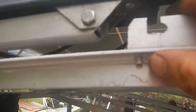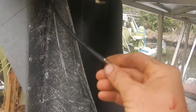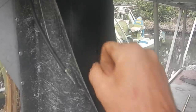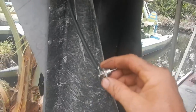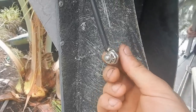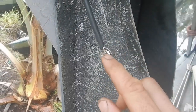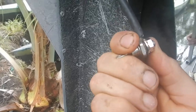Look up under here — that's the positive. I want to deal with the negative first, so that'll be that one. I have that stripped pretty far, so I should be able to wrap it around that funny washer I bent and get it locked in there. Well, it looks pretty good. With the washer bent over like that, it holds the wire in. Doesn't seem like it's coming out at all.